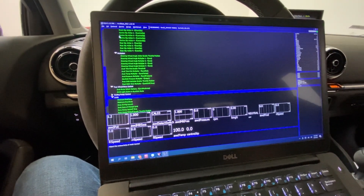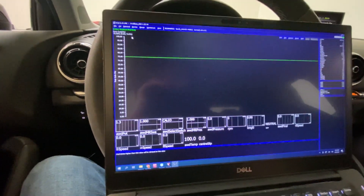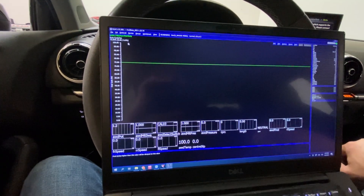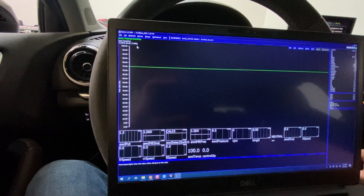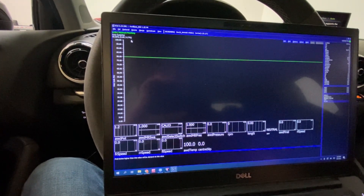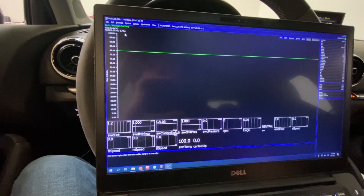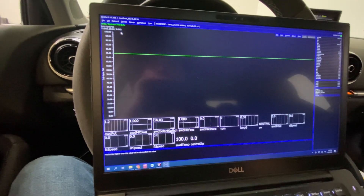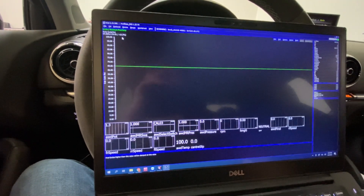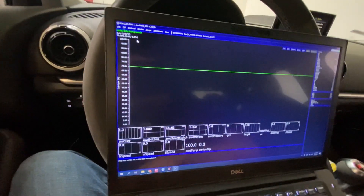Cooling pump is not relevant on the RS3. For limits, I'd recommend setting minimum at zero. Maximum is important - I get blowback from people who break axles. This is really giving you all the keys to the castle. 75 is where I have it limited on production stuff. Most of what we do we put it at 80, but I understand tires and track conditions well. You can start to break stuff at 80; for really aggressive stuff I'll pump it up to 85. If you're scared of breaking stuff, leave it anywhere from 70-75. Stock is about 60-62, so 75 is a good happy medium. Duty during launch lets you set how much duty you want when launch control is on.